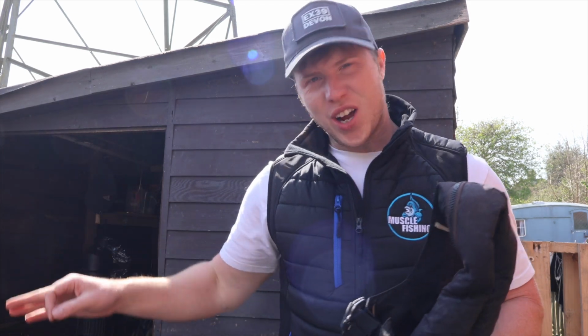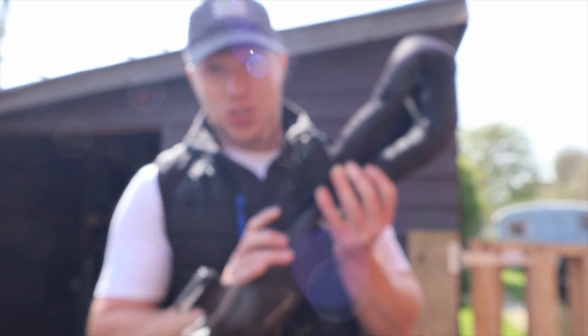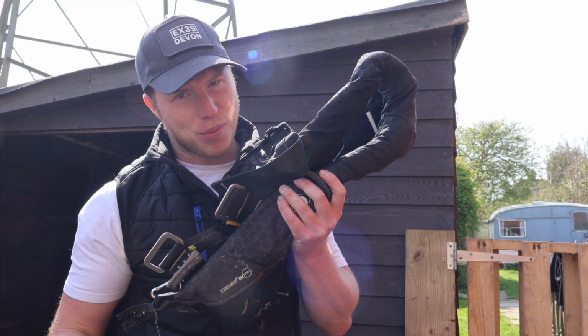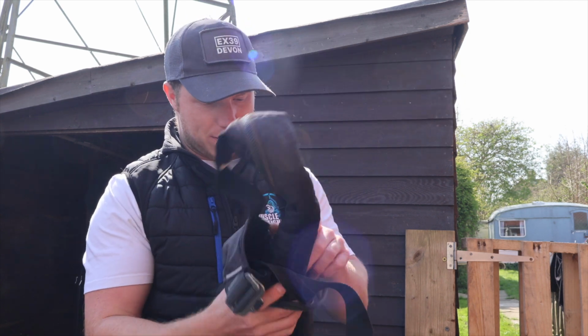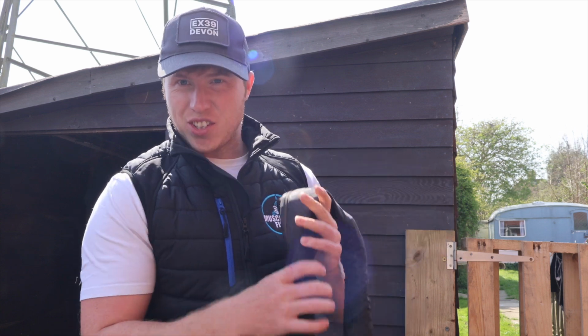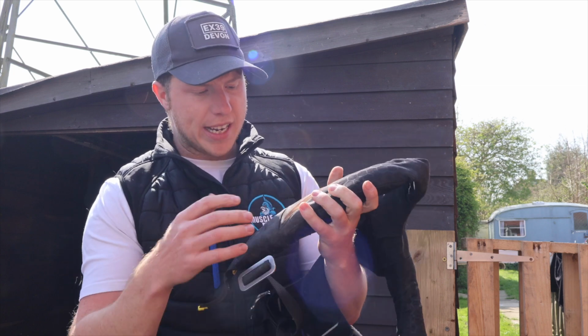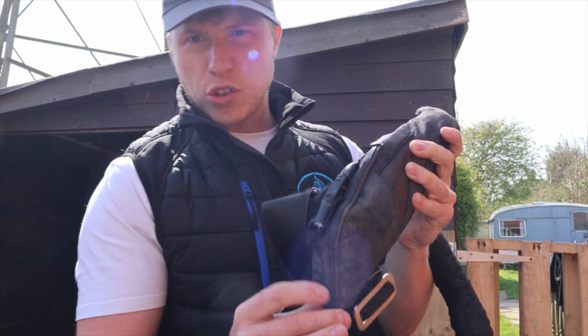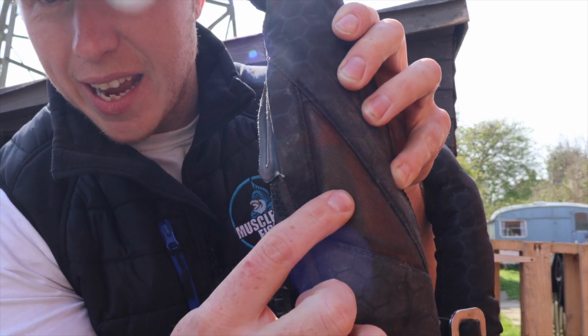Right, so the charts are now updated. They're now transferring from my phone to the plotter. So while that gets done, let's just talk about, yes, it's a boring subject, life jackets and safety kit. Now, what you want to do is make sure that your canister is in date, because the CO2 canisters on here do expire. So you want to check your expiry date, and to do that, you unzip the life jacket and check the canister, which on mine is there.